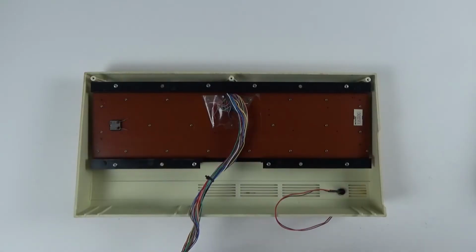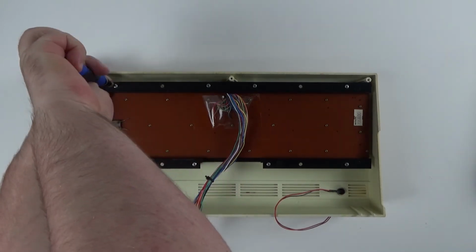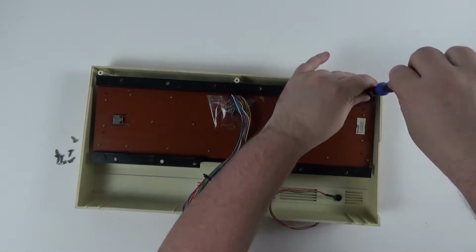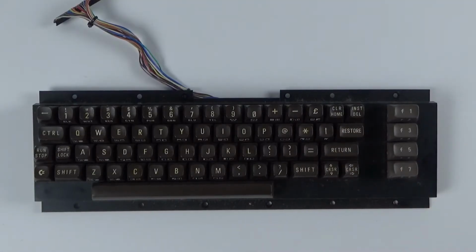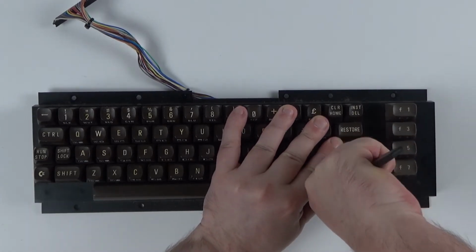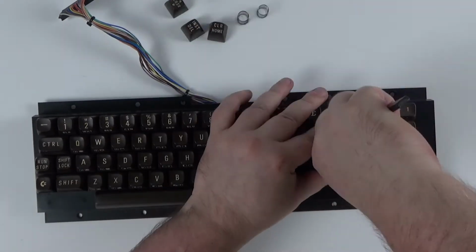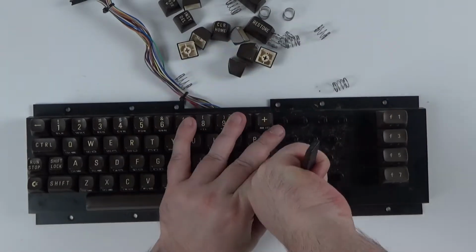The top half has the keyboard and power LED, so we need to get those out. There's several screws holding the keyboard in place, and once removed the keyboard should come out just fine. The keyboard is in good condition, all the keys are pressable so there are no broken plungers. The text on the keys are a bit yellowed, so we will clean those up and see if they need retrobrighting or not. Most likely there's decades of dust and God knows what else under the keys.